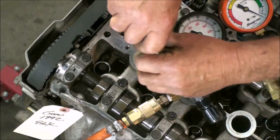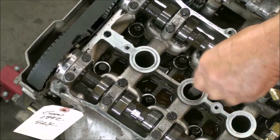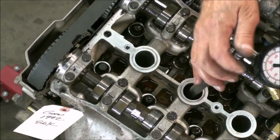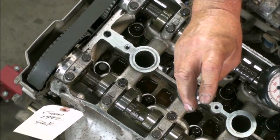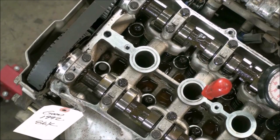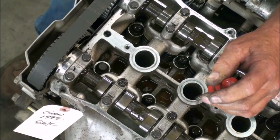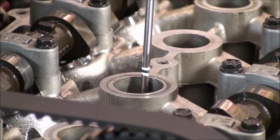Number two. Now if you were working on a V8 or something with the valve covers on, you couldn't see the camshafts and the position of the lobes to tell you where top dead center was. You can actually bump it over and put your finger on the air line — you can feel when it comes up on compression. As soon as it starts to come up on compression, you can pull your line, put in your stick, and roll it around.